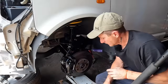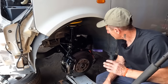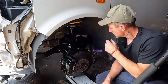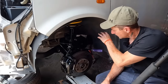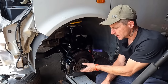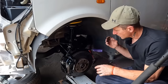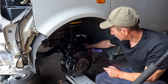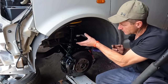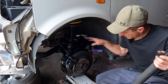It's all back together, and just one little tip I want to show. You know I love to give a little tip. When doing wishbones, whether that's a front wishbone or a rear wishbone, you don't do the inner bolts up where the bushes are with the leg fully extended downwards. If you were on a four-poster ramp, it's nice and easy because you would lower the vehicle, get underneath, then do the inner bolts up, because you want to do the inner bolts up with the leg upwards, in the lowered position rather than in the extended position.